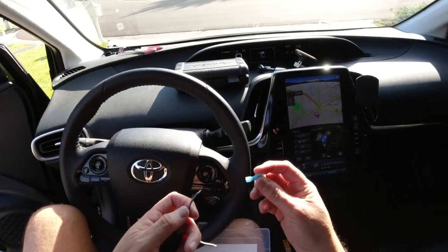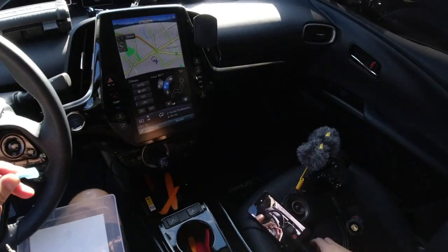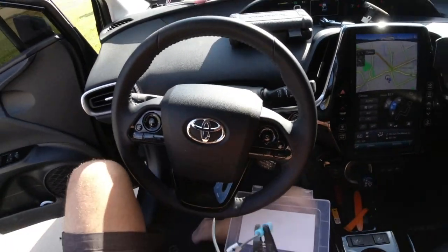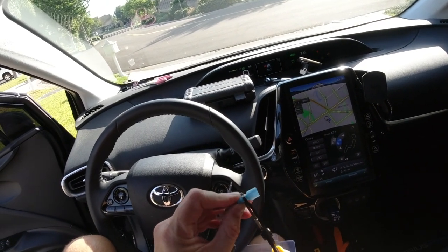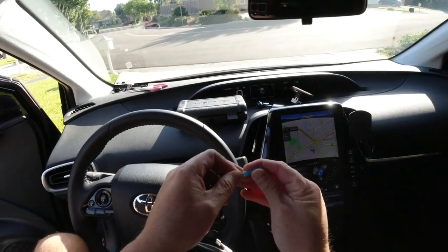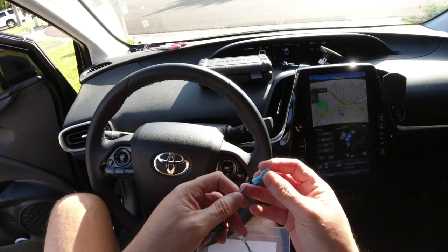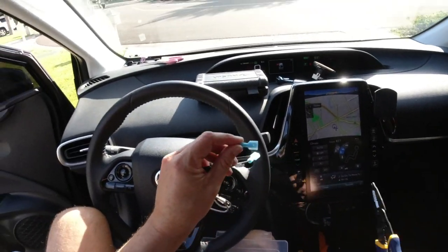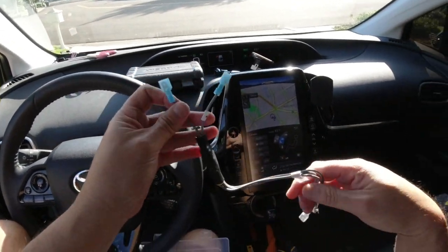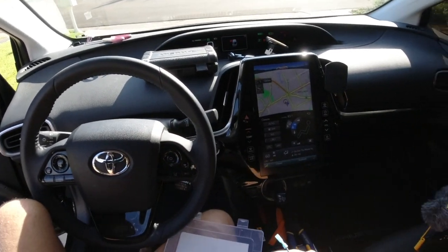These T-taps make your life so much easier. You just take one of these little guys — this thing's already cut and ready to go. Slide it in here, grab your wire crimpers, and squeeze like hell. Make sure it's nice and tight. Some of you are going to say you should solder it, and you can, but that is tight — it's not going anywhere. You've got that side and then this side with the negative. That is a perfectly tight and perfect connection. These are both solidly tight. Got this for about 10 bucks. I'll put it in the description below with all the different sizes of T-taps.